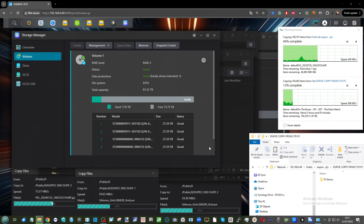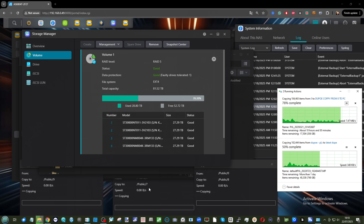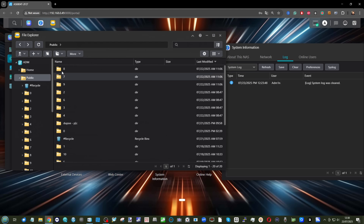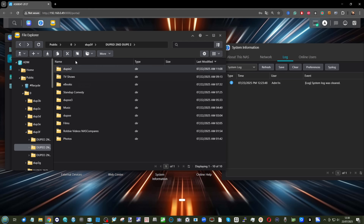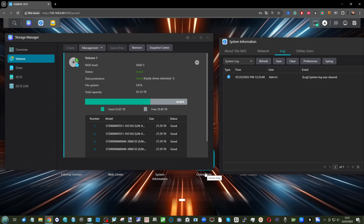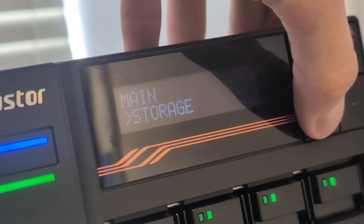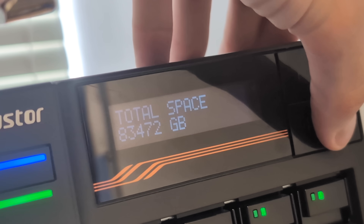When I wanted to do the RAID degradation test to see how long a rebuild would take, I put some data on this first. I decided early on I wasn't going to fill it to 100% — most users won't have it at a hundred percent and leave it; once it gets to that point you're going to start swapping out drives. So I aimed for 50 to 60% fill using lots of mixed data — photos, video, documents, general multimedia — kind of average day-to-day stuff rather than just block-writing via SSH, which felt less realistic. In the end, because it ran overnight and I wasn't always in the office, I ended up filling it to 63.82% full.